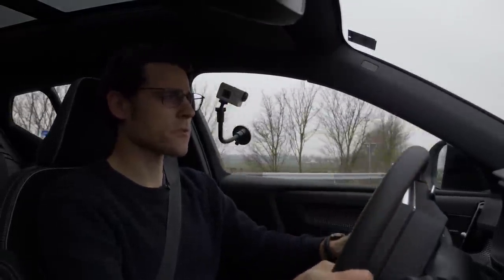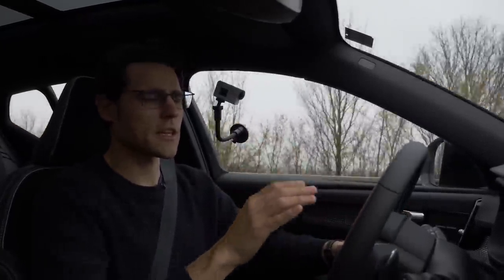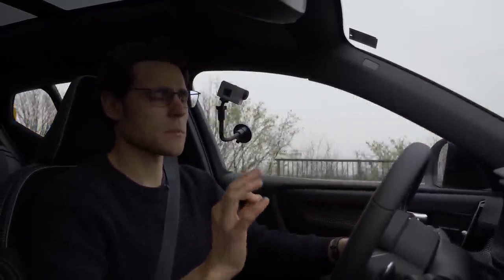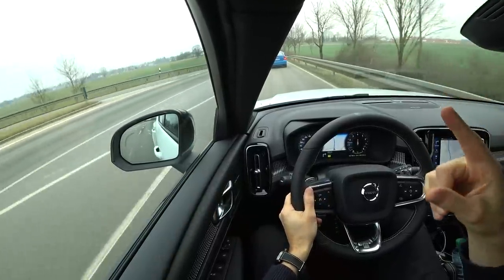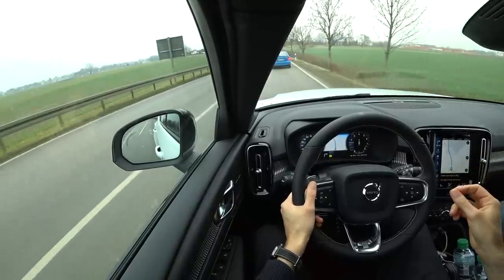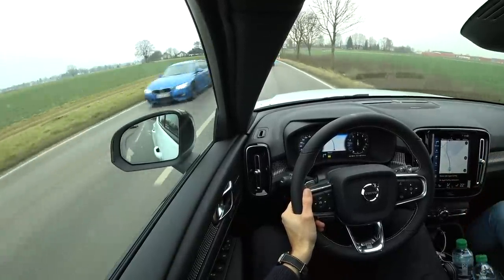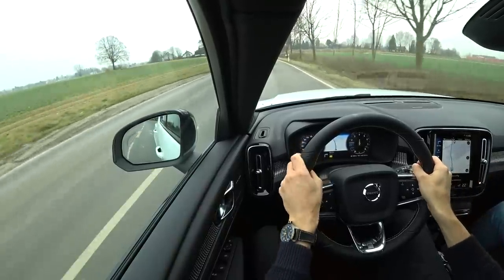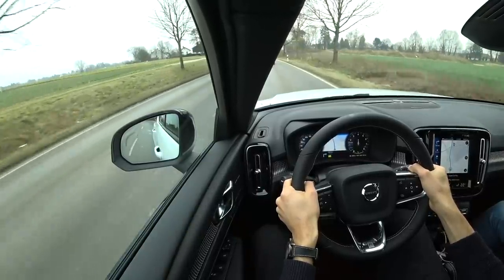You may have seen the red warning triangle in the front of the digital cockpit. That one warns that the front hood would be open, which is not the case — the sensor is somehow malfunctioning when closing the hood. This can sometimes happen when too much grease has been applied around the hood closing area, blocking the electronic contacts. So they have to be cleaned. If such a thing happens to you, ask your dealer at the next workshop — that should actually help.